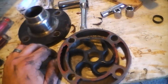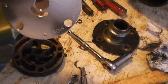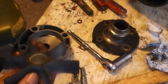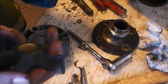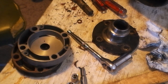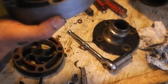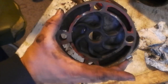When you're ready to install your new impeller, take the new plate — it'll also have a new metal side. Make sure when you put this together that where it says 'pump side' on the plate is facing the pump side. To get the impeller in, take some Dawn dish soap — you can use Vaseline or a grease that's safe for rubber, but Dawn works and it's in just about every kitchen. Put some Dawn in there; don't be stingy about it. This is mostly so when you start it up it's not putting a dry start on that impeller.